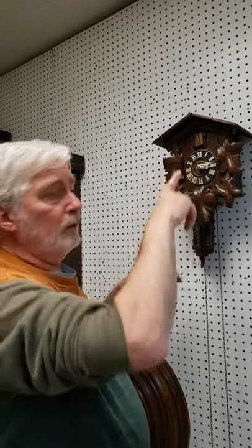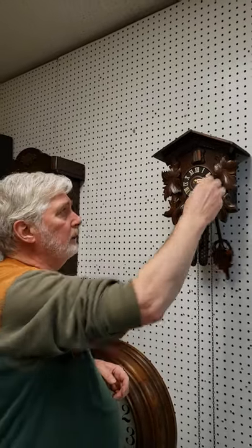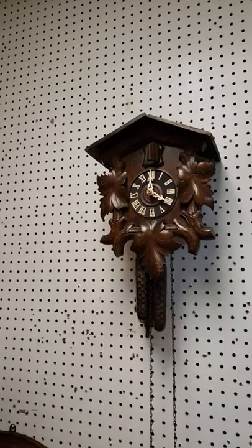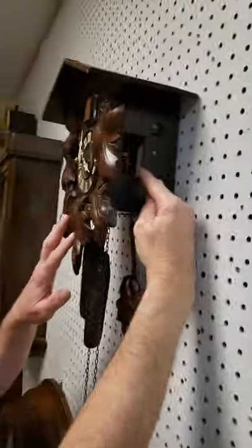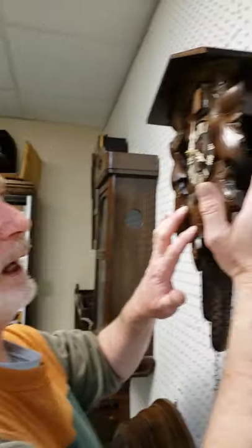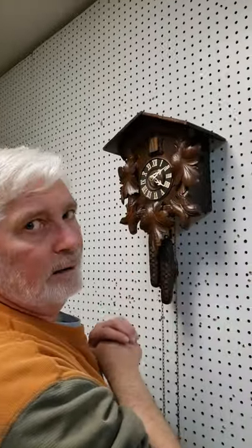One thing you need to know about this clock is that it will go out of sync if you move it without stopping, or if the clock runs down without the cuckoo stopping. Should the clock go out of sync — say it struck four times — to correct that, go up to the closest hour, four o'clock. Take off the little access door on the right-hand side, the three o'clock side. There's a little wire, and if you push on that with your finger, it'll trip the cuckoo. Trip the cuckoo until it matches what time it shows on the dial. Once it's back in sync, you can go back to moving the hand and setting it to the right time.